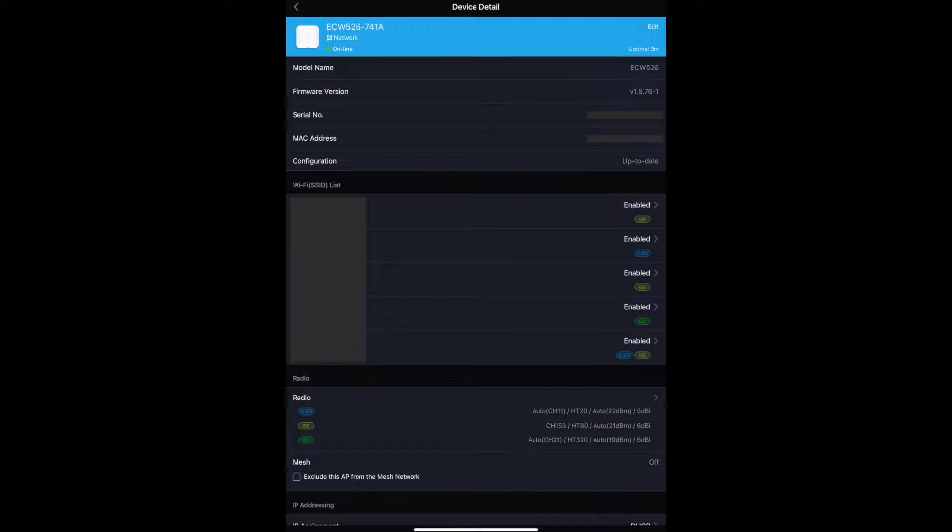It's been a couple of minutes and I initially set the access point up with gigabit ethernet, but I've moved it to a 2.5 gigabit ethernet network and mounted it on the ceiling. In the app, if I go to Access Points, we'll see it listed — it's connected up to the network, and since it supports 6 gigahertz, we have a 6 gigahertz network available. So let's open up a browser and do a speed test.